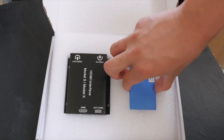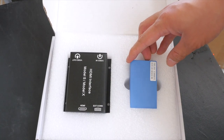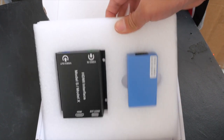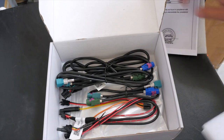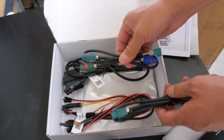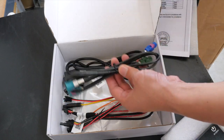This one over here is a CAN bus controller. This is how we're going to make the menu button on the steering wheel control the switching to the video input from your backup camera. And at the bottom you'll see some cables — there's going to be two camera cables, a long one and a short one. The short one is used for AP2 vehicles, the longer one is used for AP1, so we're going to be using the longer one today.